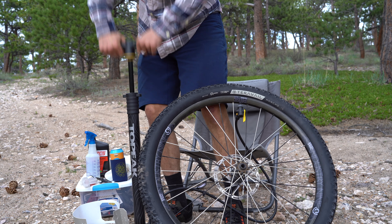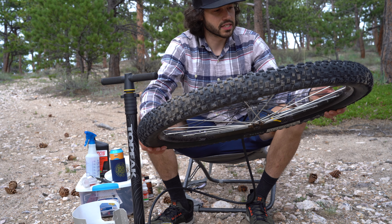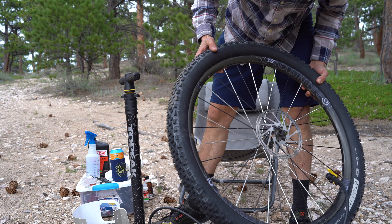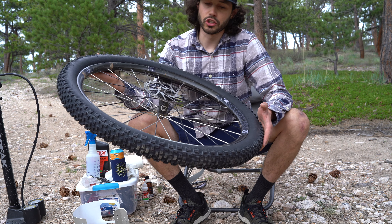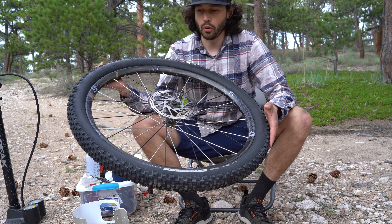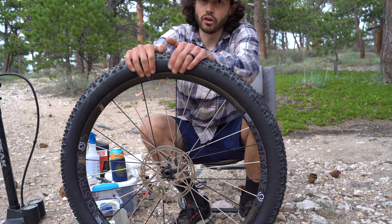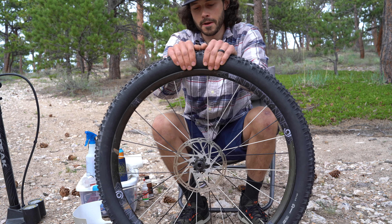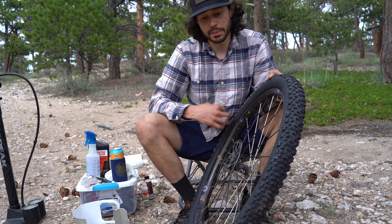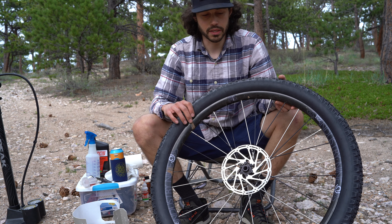We're probably going to hear some popping, and that means we're seating the bead. I can see the bead just working its way — pop, pop. Trying not to get the PSI up too high is important. If you run into issues seating that bead, pulling over on the side of the tire is very helpful. Sometimes I use soap if it just won't go, especially on higher-pressure tires — more like gravel or road-style tubeless setups.